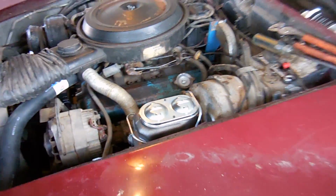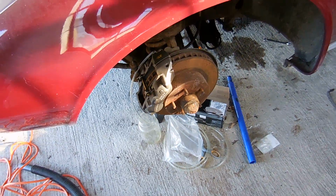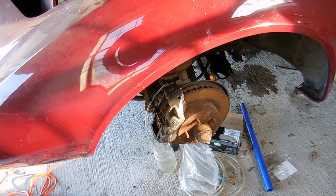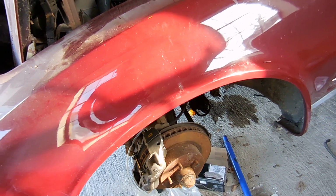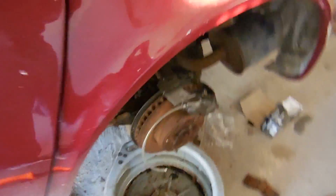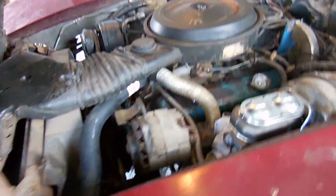What I'm going to do today, which is something I recommend you guys doing if you have any kind of brake problems, if you're bleeding the brakes and you're by yourself, is I'm going to do what's called a gravity bleed. So I open the bleeder on all the calipers, and then I let gravity pull fluid from the master cylinder to each bleeder, and I have a catch can for every corner of the car. What this does, I don't believe that this completely bleeds your brake system, but it definitely helps. It gets fluid everywhere it needs to go.